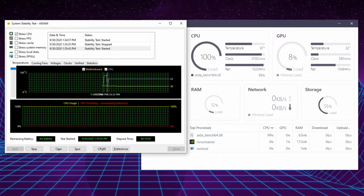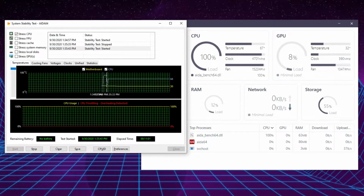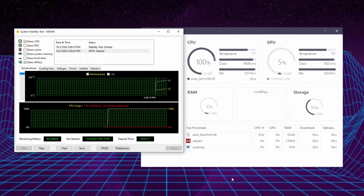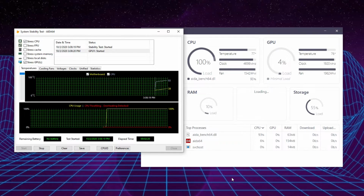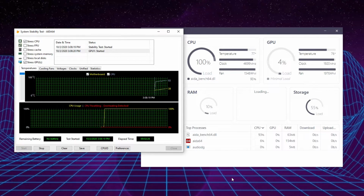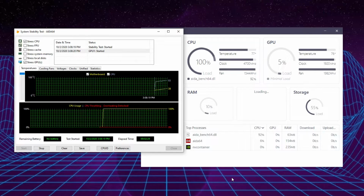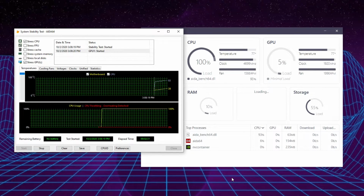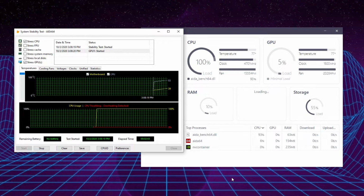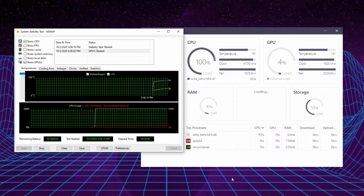When we're talking about the graphic card temperatures in full load and the maximum performance of the graphic card, it got 79 on average, 80, and I would say that is extremely alright, because testing this GPU on multiple cases, it actually showed the exact same temperature. So the difference between this case and a front open panel case with meshed front and stuff like that, it didn't have any differences whatsoever. So 79 to 80 degrees, it might touch 81, 82 depending on the load, but 79 and 80 degrees is quite safe for this kind of case.